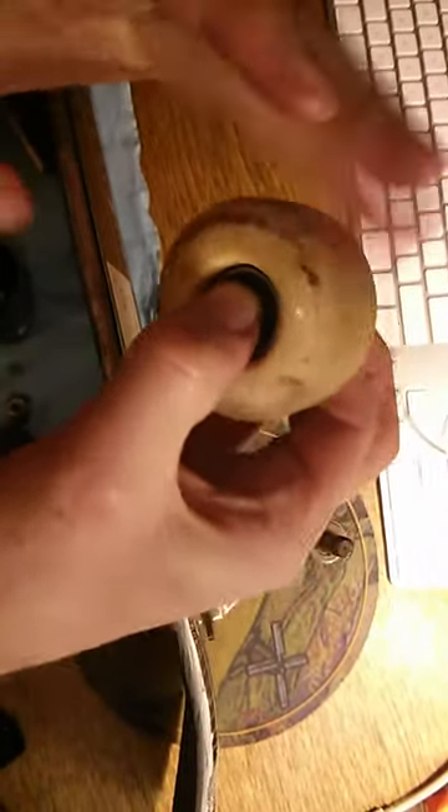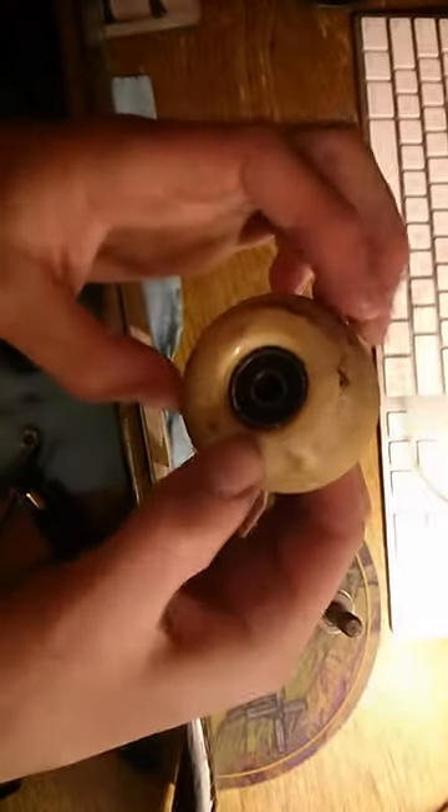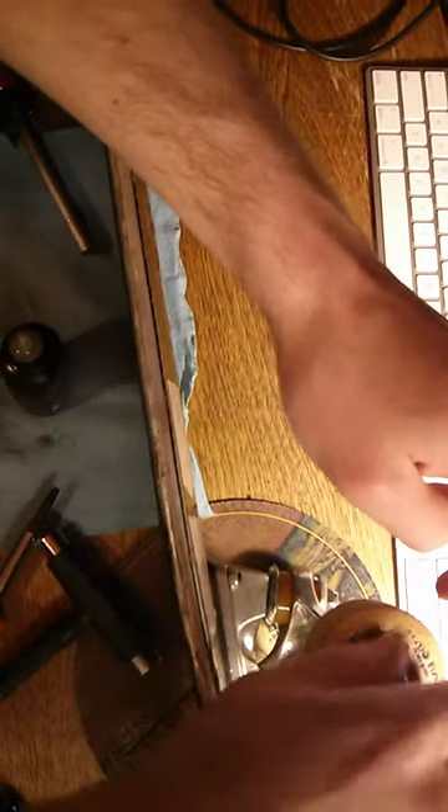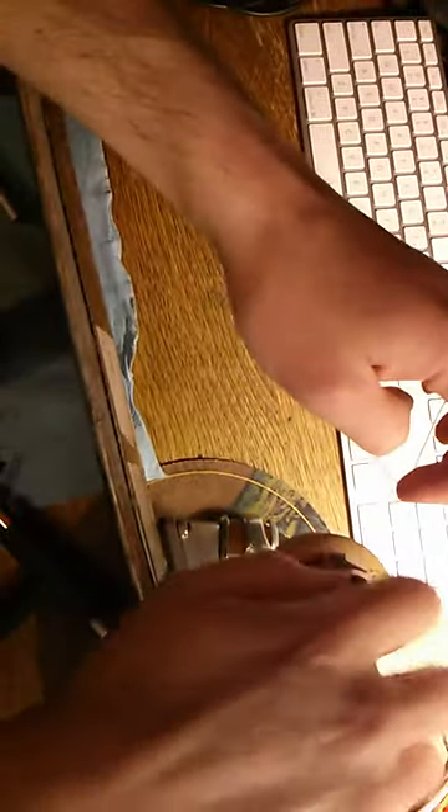So that's how you lubricate your wheels. I just did one bearing — you need to do it to each bearing on each side for every wheel. Then you put it back on, put the washer back on, and then put your nut back on. And that's it.